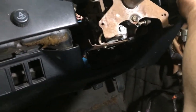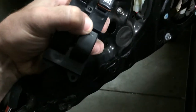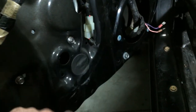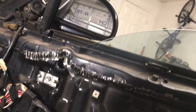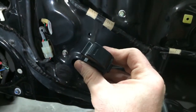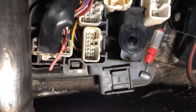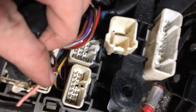Let's see if these switches work. That's a negative — window locks or door locks? Well that must go. Let's try the passenger side. I think some of the issue I'm having is the wiring harness over on the driver's side. This is under the driver's side kick panel where all the wiring goes, and if you can see, these are some cut wires. I don't know why they've been cut, and something has been spliced and electrical taped. So I'm just going to have to dig into that a little bit.